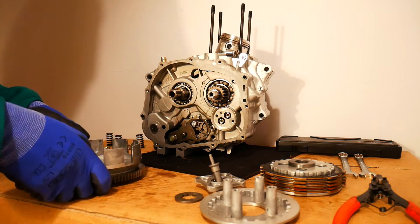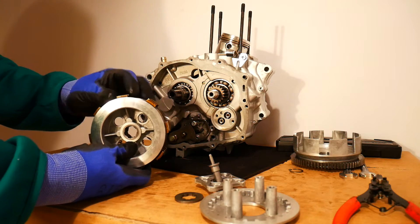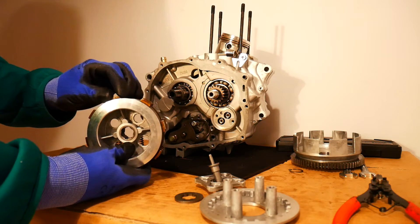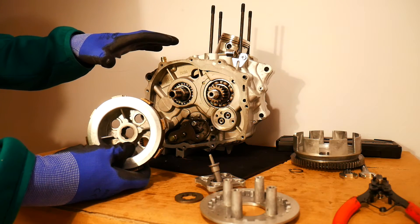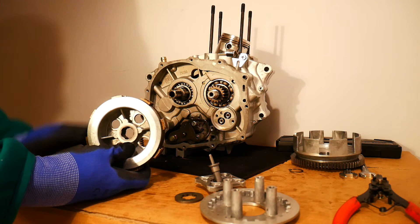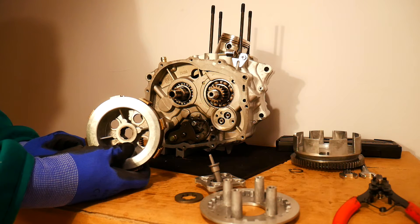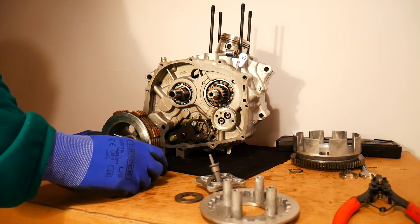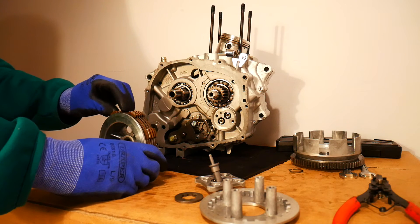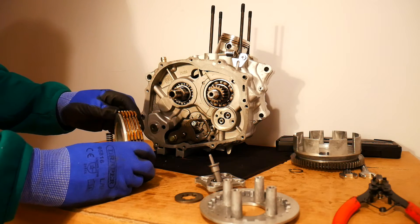So how do you know whether your clutch is good or bad? If the clutch is doing its job, when you pull on the clutch cable you should be able to come to a stop — the engine still running and the motorcycle not moving. When you start to release the clutch lever, your motorbike should start moving again. If you release the clutch lever and the motorbike is not moving, or is struggling to move, or the revs aren't translating into motion, it's a sign that the clutch discs need replacing.